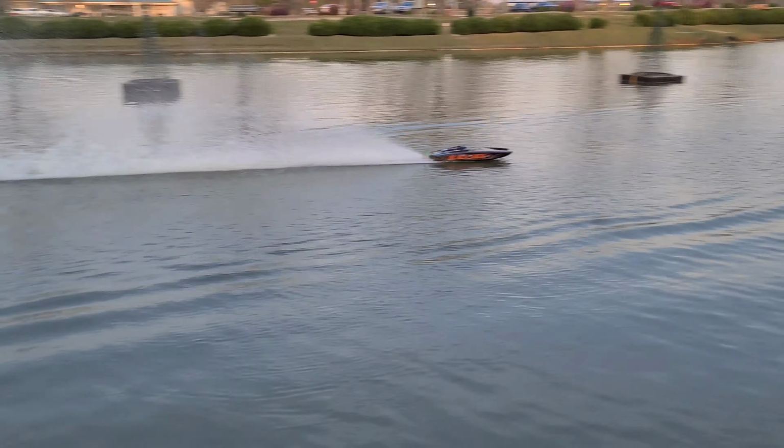My first hole, I mounted my trim tab basically in line with the bottom of the boat, okay? It did good, but I didn't like it. So on my first hole, I actually moved them up 2 millimeters. And it did good. I was getting some high numbers. The new hole, I went ahead and mounted my trim tabs. I used my caliper today because I had somebody comment about it. They're exactly 4 millimeters higher than the ride surface.